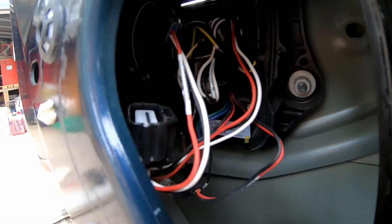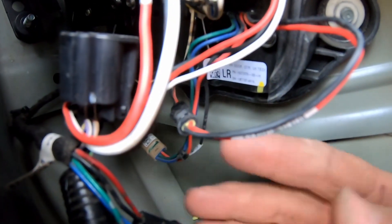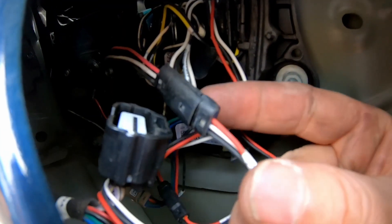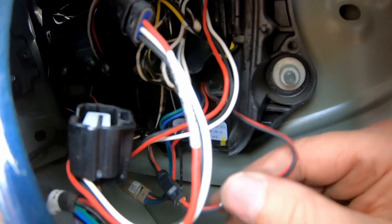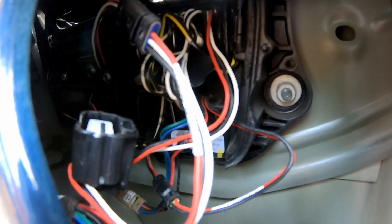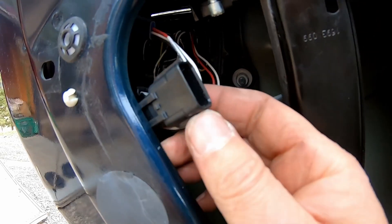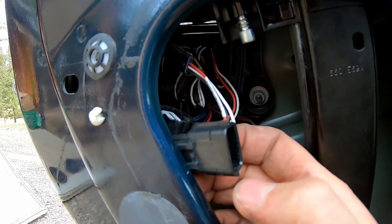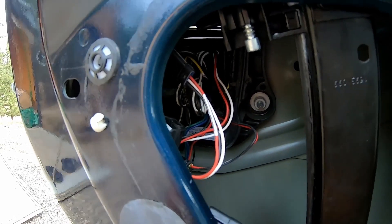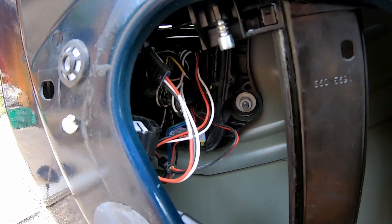It is a little hard to see in here, but down here there is a plug right there and then there is a plug right here. So these are the two plugs that I can unplug — they go to what looks like the motor and the light; I'm not 100% positive. But I can unplug one, then plug the big one back in here and see if my light comes back on. If my light comes back on, my short is still there. If my light does not come back on, I unplugged what has the short on it. So I'm going to test that and we will go from there.